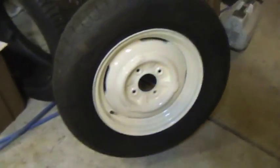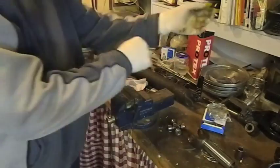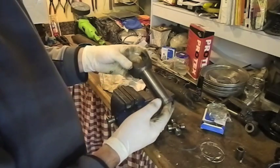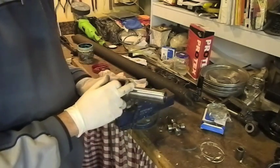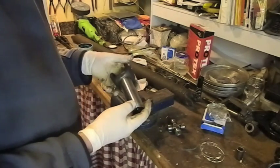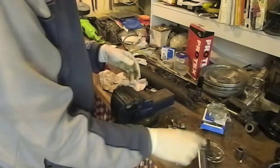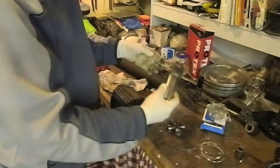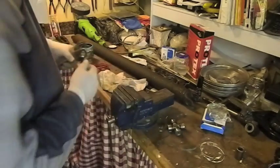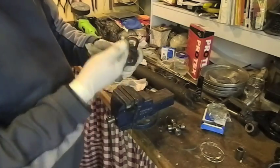Spare wheel's finally done. It looks absolutely beautiful. Can't wait to get the other four tyres. Ready to start putting this front uni in. I've resurfaced the slip joint here. When you put these in, you don't want to put them in dry because you can damage the seal. The best thing to use is Snow White Petroleum Jelly because that won't affect the clutches or bands in the transmission. You can't use normal grease. So I've decided to clean that up - it's easier off the tail shaft. I'm just going to put a slight bit of grease in here so I can put these cups in nice and easily.